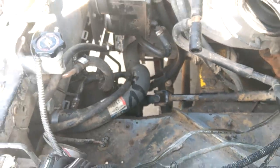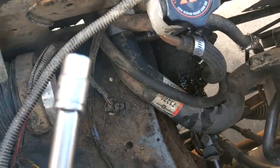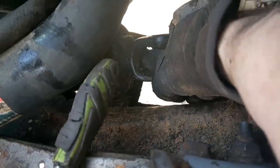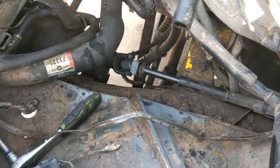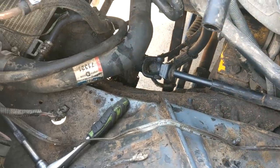Now it's just down to removing the steering wheel shaft — the in-betweener. I think it's probably just a little bolt that slides out — it's just a bunch of splines. So we've got this little Loctited bolt here — 7/16ths — that's just in the side of this joint. I'm pretty sure the shaft should be free; it's just getting it on and off that's going to be interesting. I'm going to get underneath and see if I can cradle that down and see if she slips out.